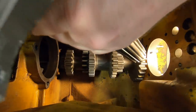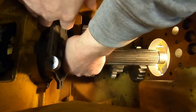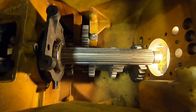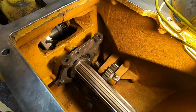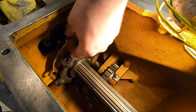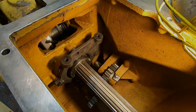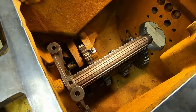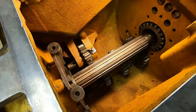We start by placing just the pinion shaft in - not messing with shims yet because they can be inserted after this is started. I've started the bottom two bolts on the bearing cage. It's convenient the way they slot the bottoms of these shims - you don't have to take everything completely apart to slide them in and out. Shim pack is in place and we've tightened down all three of the bearing cage bolts. We're not too tight on backlash.